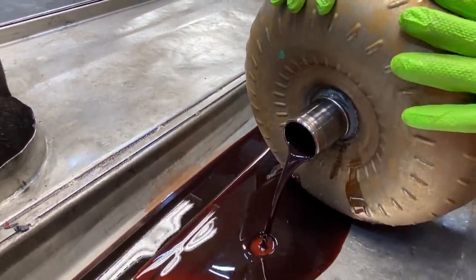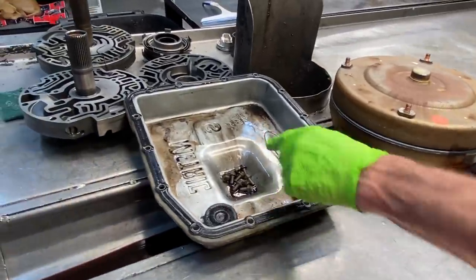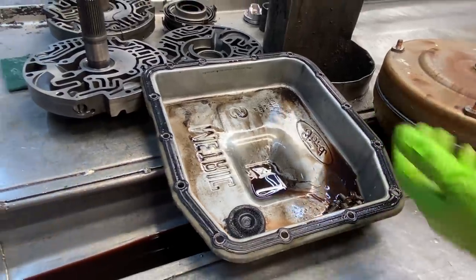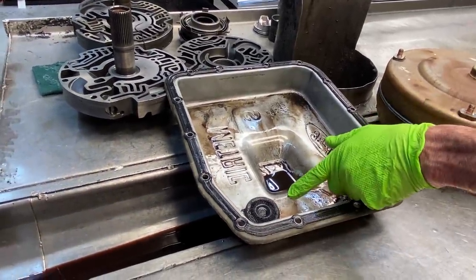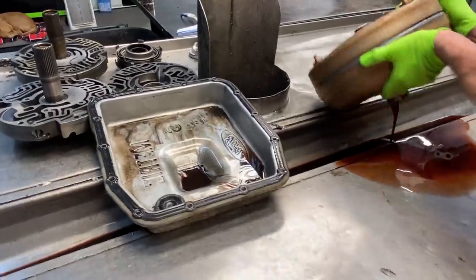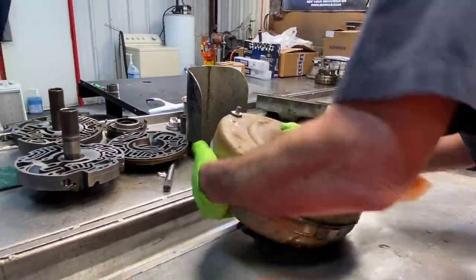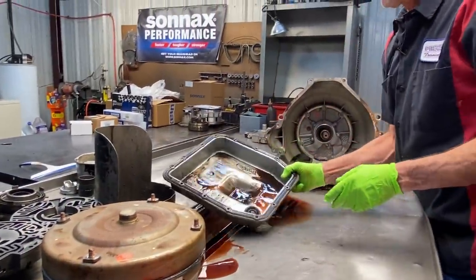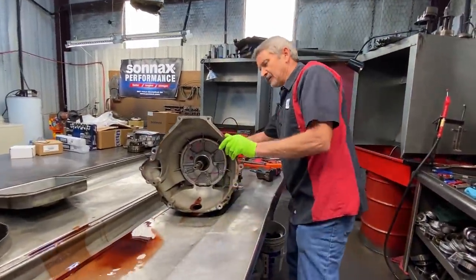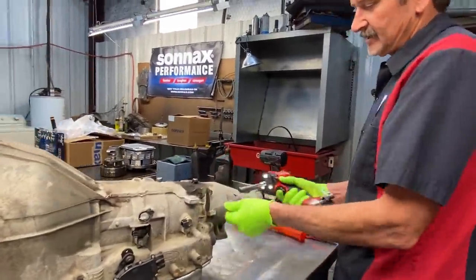You can see the pan — this is not a four-wheel drive pan but a two-wheel drive deep pan. We switched the pan over so we can get it out of the vehicle on the jack real easy. You can see all the material on the magnet, all the way through the pan. It has been serviced before — you can tell because there's no little yellow plug in the pan. A lot of these when the pan's never been off before will have a little yellow plug in there that tells us it's never been serviced.